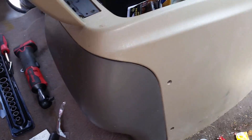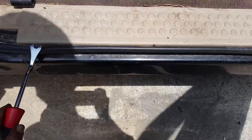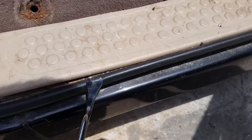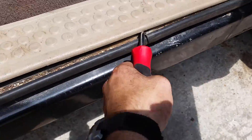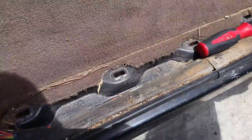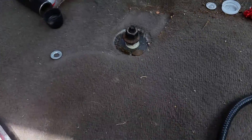For the center console there are going to be four 8mm bolts underneath; you can just reach down in your center console to get to them. Use a flat head screwdriver for the little things inside your doors — just reach under there and pop the little clips up. You're going to need to pull your carpet up, so pop these clips out, and now you get to your carpet. Go ahead and put your bolts back in place so you don't lose them, then grab your carpet and pull it out because you need to get to the bolts that hold the body onto the frame underneath the carpet.